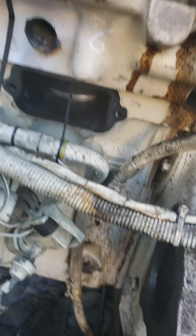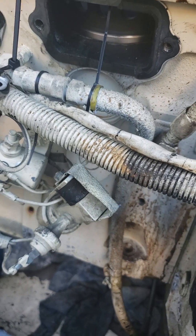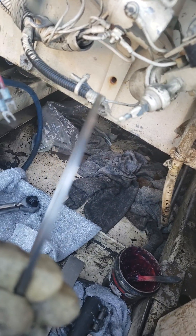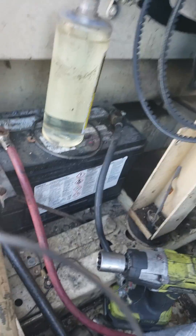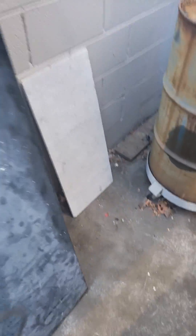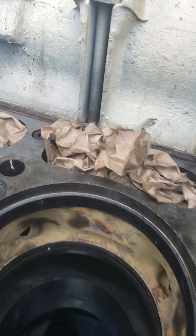The way you determine the right size ring is if you're a little under or a little over, you've got to go thicker or thinner on these spacers here. These spacers are new from Detroit — they actually do not come in the rebuild kit, which surprised me the first time I did this. These spacers fit right in here.